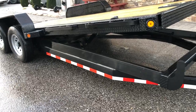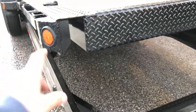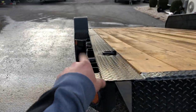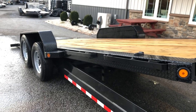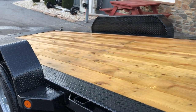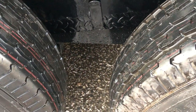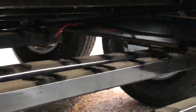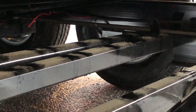We have a six-inch channel tongue and six-inch channel frame, as would be typical in the industry on a 14,000 pound trailer. One neat thing they've done is nestled the frame inside the fabricated part, so your fenders match up with the fab part and you get full-width loading — about 83 inches fender to fender. That's an impressive feat because this unit also has torsion suspension. Normally with torsion you lose a few inches of width, but on this you still get full-width loading. With torsion there's no spring hanger in between — the suspension components are all contained within the axle tube itself. Very smooth setup.